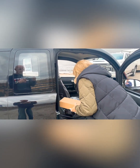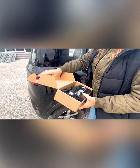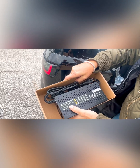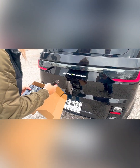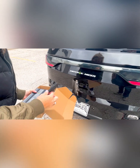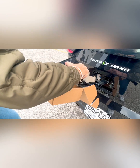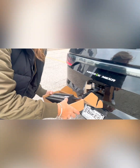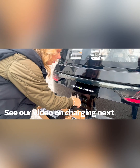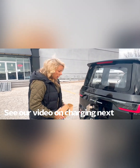Speaking of charging — it comes with your charger. It's a 60-volt lead-acid charger, actually a pretty fast nine-amp charger. It's a regular charger, no installation needed. One end goes to a regular 110-volt wall outlet, and your charging port is right here. The indicator light — red means charging, green means it's done. If you've run it right down, this is a good ten-hour charge. Charge it until it goes green; if it's still red, keep going.